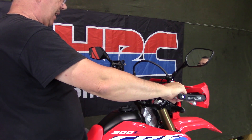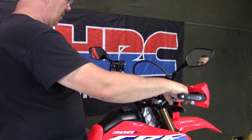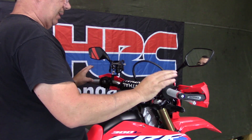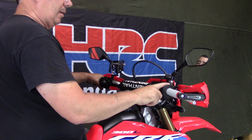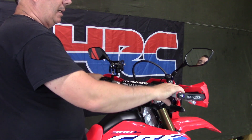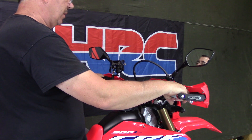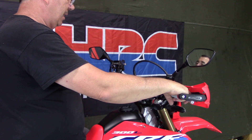One last look - you can see what they look like from the front and the color match is actually pretty good with the plastic. This is the red and black version of the hand guards. One last check to make sure the throttle is nice and solid, snapping back like it should, and all levers work good. Check lock to lock to make sure we're not pulling the throttle or clutch levers. These are a lot nicer, taller bars - the Jimmy Button bend high bend Renthal bars. I'll post a link to CRSOnly below. Make sure your throttle housing is nice and solid and not going to rotate for safety reasons. Do this at your own risk, as you should with anything working on a motorcycle. Thank you all for watching Woodsman Adventures - click thumbs up, subscribe, and I'll catch you on the next one.